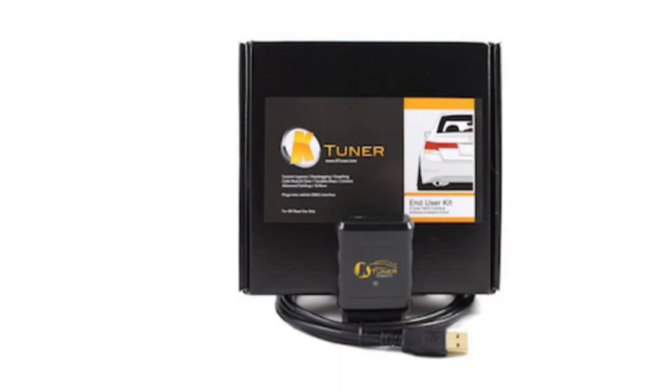When it came to tuning, I have to give this one to ktuner. The ktuner software has a bunch of drop-down menus that make things a la carte — you can pick and choose what you want to do. With hondata, you really have to have an experienced tuner who knows what they're doing to set up all the different tables. The tables in both look essentially identical, but the drop-down menus in ktuner make it a whole lot easier. For example, you can set stock boost at 16 pounds, then have it go up to something like 23 pounds in sport mode. Hondata has the same option, but you usually have to get it professionally tuned.